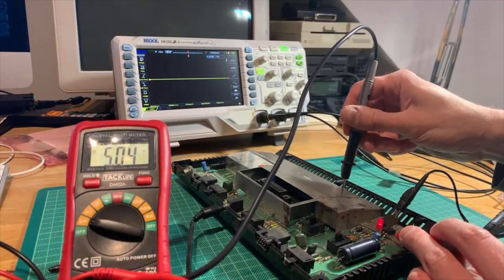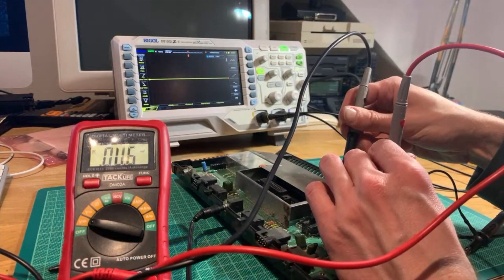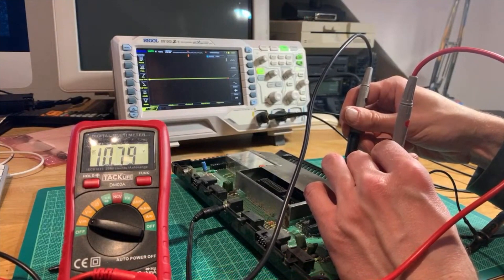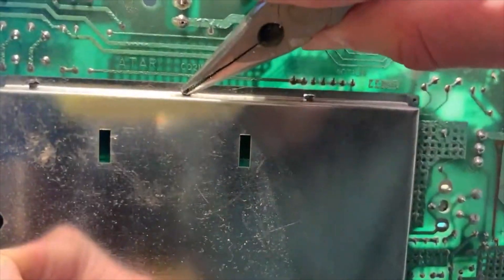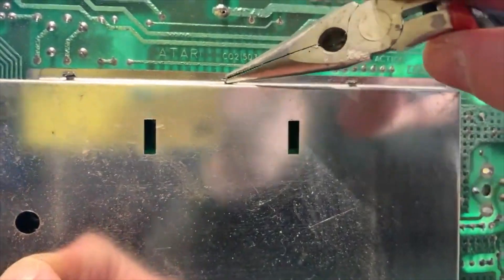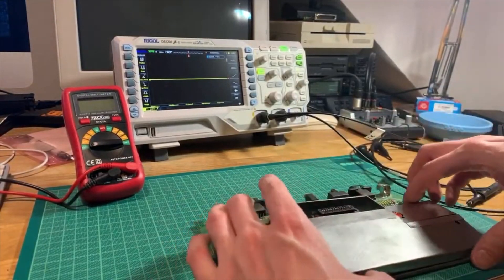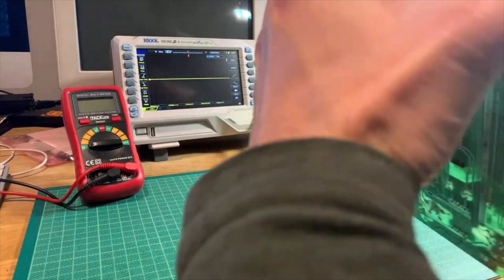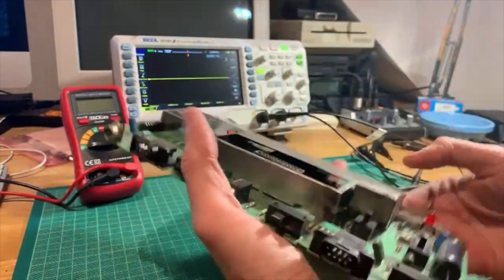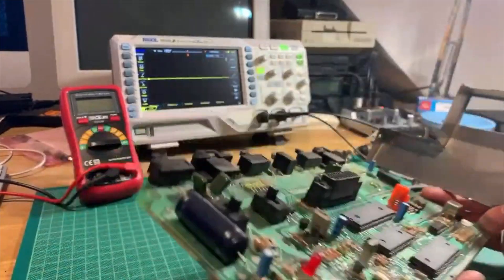Next step is to measure the voltage regulator, and it's still putting out a nice five volts, which is good. And also on the other side, we see roughly 10 to 11 volts, which is a little bit on the high side, but seems to be fine. Afterwards, we are removing the metal RF shield, where you have to twist those tabs open. So this procedure is totally reversible and doesn't require any soldering, which is quite nice. I also checked out the signals on the CPU and the video output with my oscilloscope, and it looked fine. So the mod should be very well possible, and the machine is not dead at all.